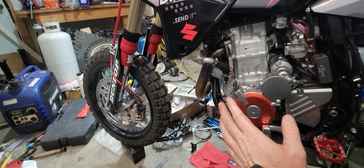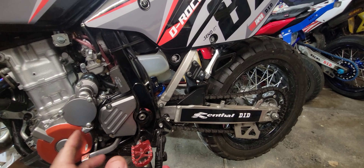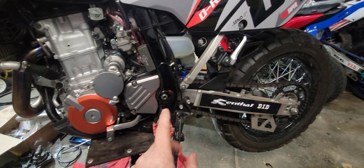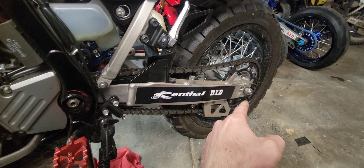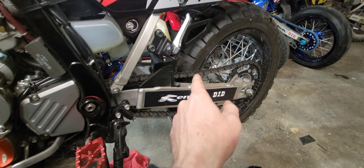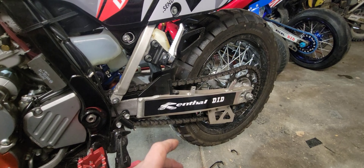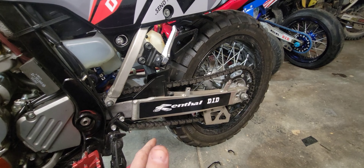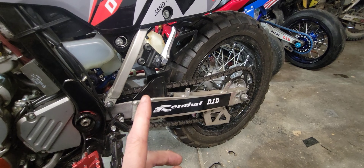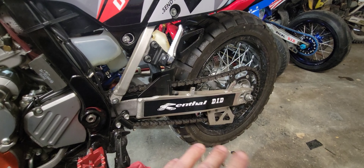Even though we're going to do the front, I'm also going to focus on the rear because we're going to follow the same process for changing the tire. We've already removed the axle sliders and the chain guard. This is a good opportunity to swap out with some Allen head screws if you're going to leave your chain guard in place. I suggest you leave your chain guard in place, but they've got those same stupid Japanese standard screw heads and I don't like them.